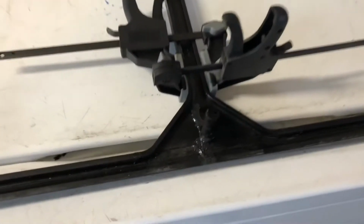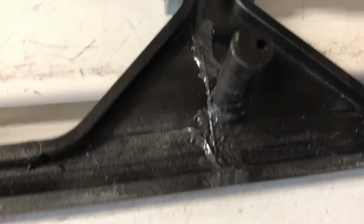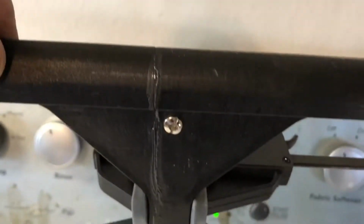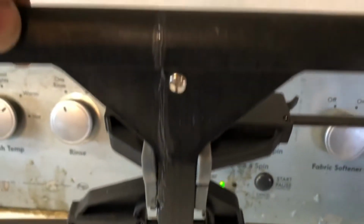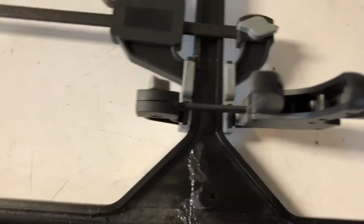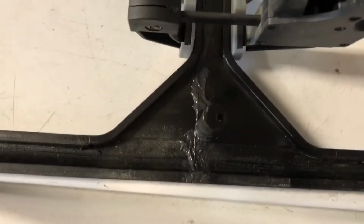All right, so the JB Weld has been mixed up, and I've put as much as I could, as cleanly as I could, into the speaker bracket or speaker frame grill thing. So that's going to hold, and it's going to need to cure for about 4 hours. So I'm going to keep it clamped up like this. We're going to leave this here.